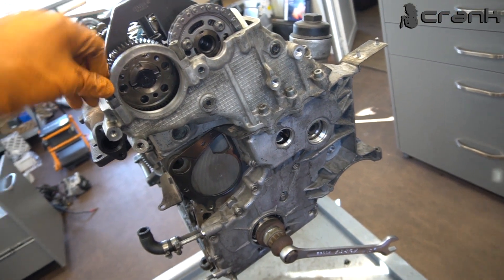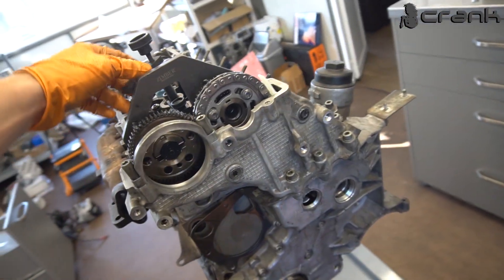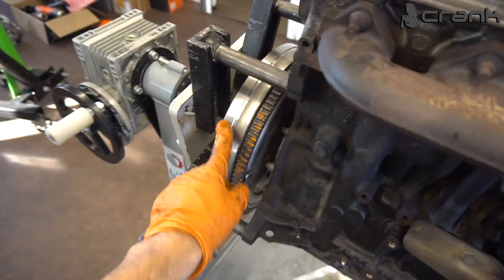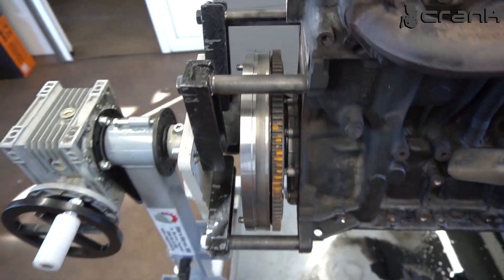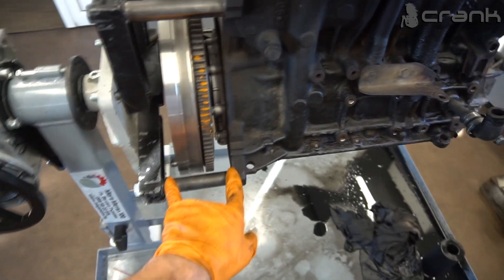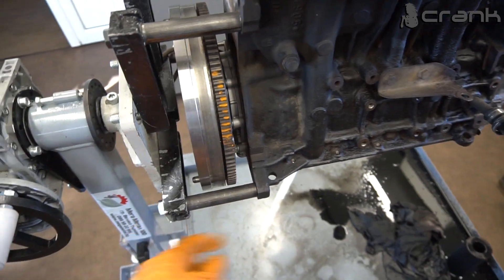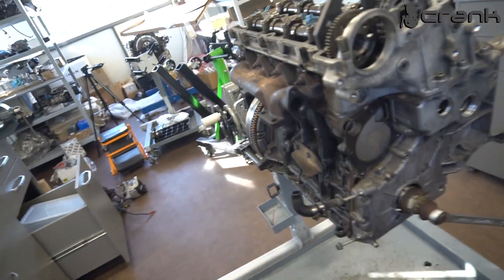The only thing left is to install the third bolt, but I just wanted to show you that it's pretty straightforward — how to install it, whether it's M47 or M57, whether it's an automatic or in this case a manual gearbox. This is a dual mass flywheel, which is why we installed such a long sleeve on the engine stand. I'm actually starting to think about producing and selling those sleeves, because it's annoying to find the right bolt and sleeve.